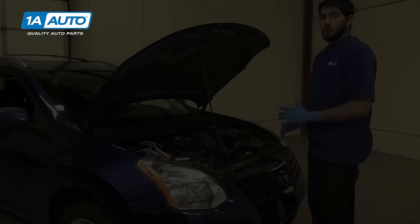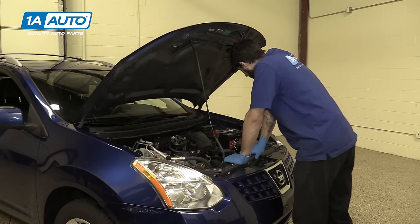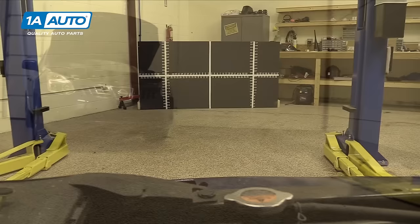After you've checked all your other things like your air pressure and the weight in the vehicle, you'll want to jounce your suspension. And what we mean by that is grab a firm part, either the bumper or the radiator support here, and rhythmically bounce it up and down a few times and allowing the suspension to settle. This will make sure that it's at its appropriate ride height and isn't stuck in an odd position. It'll just set everything level into the proper ride height.